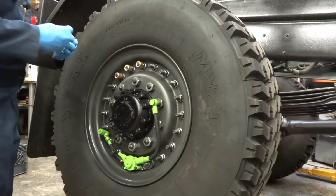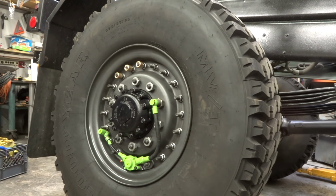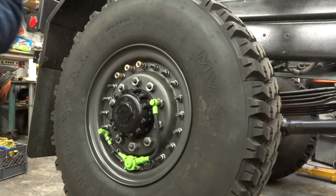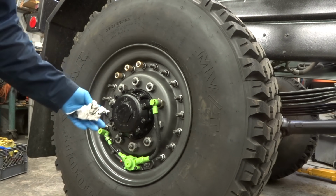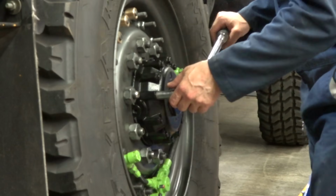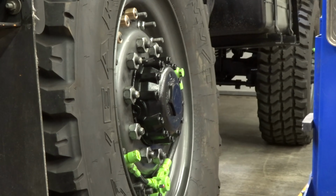Okay, so note to self, well, note to everybody else: you don't need a bead like it shows on the little instructions. All right, we'll wait an hour and torque the 12 bolts down. And then we'll wait until tomorrow, fill it with oil, and see if it leaks. Gonna do some tasty close-up torque in action. All right, we'll wait until tomorrow, and then we'll fill that thing up with oil, and then we'll lower it and take it for a test drive.